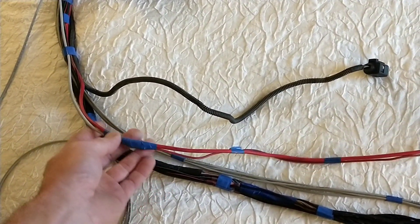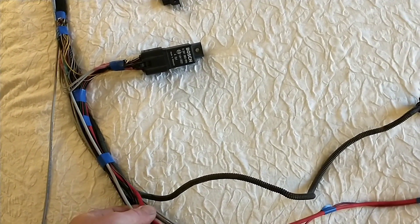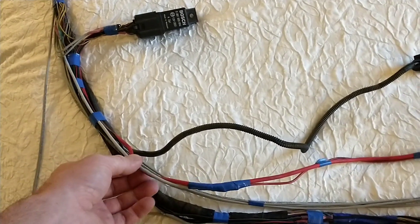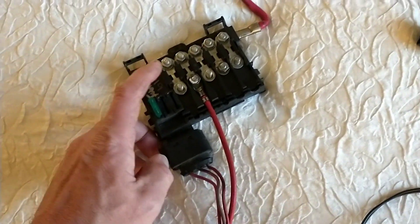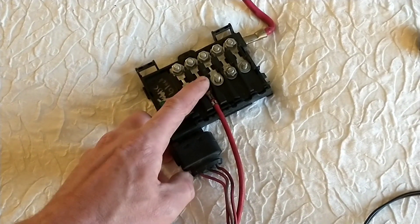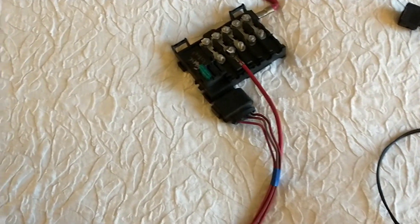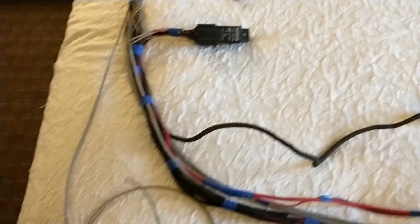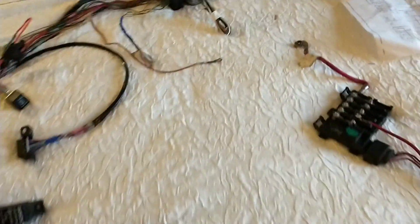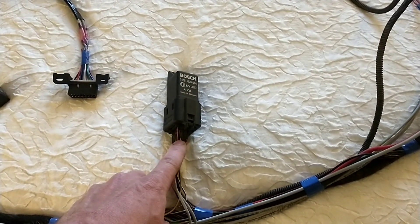For main power, I reused the glow plug relay's larger wire — I think it's eight or six gauge — along with my 12-gauge wire for the 30-amp fuse. The 50-amp fuse for the glow plugs remains the same, and I used one of the 30-amp fuses already in the harness to feed that main power to the relay. This will go to the battery just like it did before, this goes to the key, and then your ground — and that's all you need to set this up.